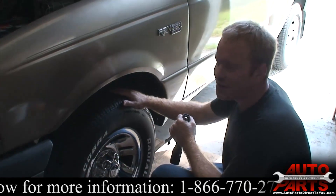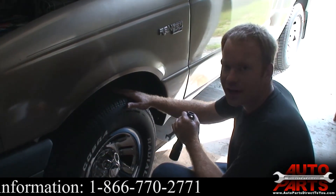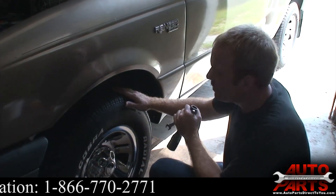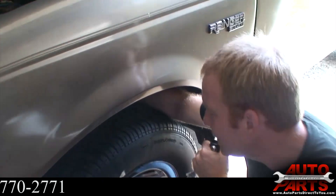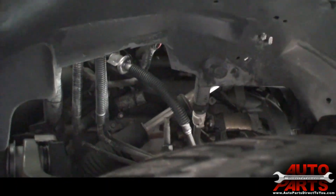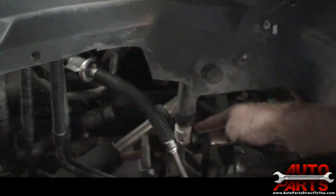To get to most of the starter you actually get to it right through the wheel well. On this truck you don't even have to pull the tire off to get to the bolts. All we have to do is look up in here — there's one little splash shield that you just pull on, move that out of the way, and the starter motor is right inside here. You can see the power cable going to it, this is the starter signal wire, and then there's a ground that bolts up in there too.